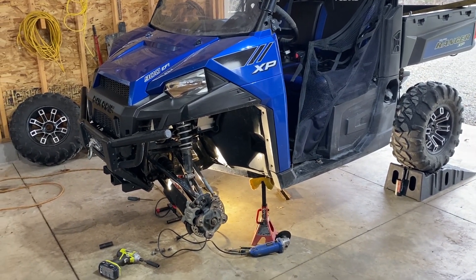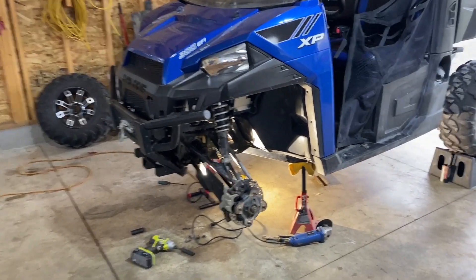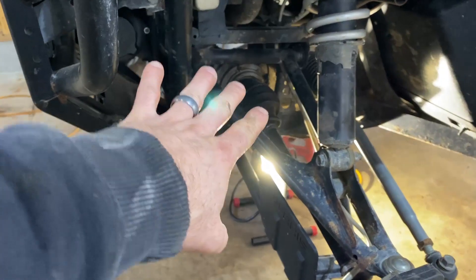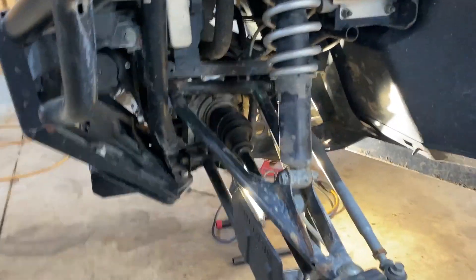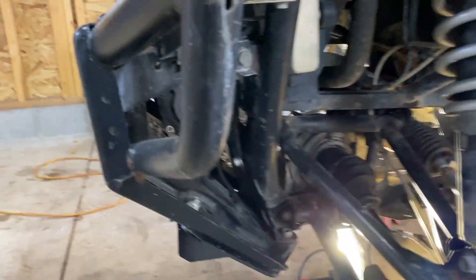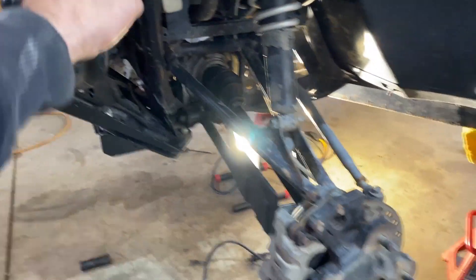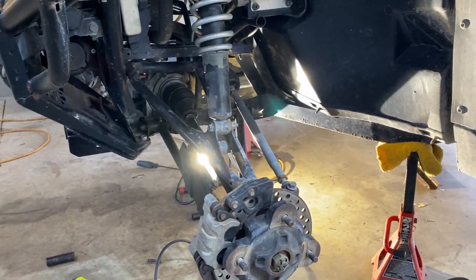When I was researching how to do this, there's tons of discussion and a few videos online that all pretty much say you need to remove the front diff — meaning you need to take off the grille, the bumper, drop the suspension, maybe yank the axles out, and then you still needed to notch the frame right in there to give yourself enough room to slide that prop shaft out the front. That seemed a bit crazy to me.